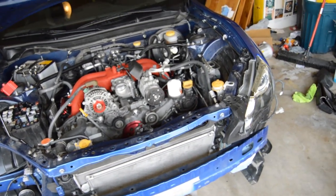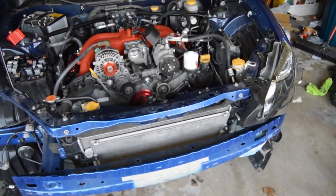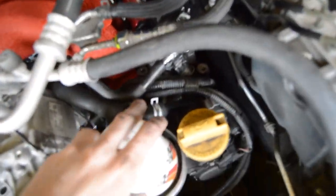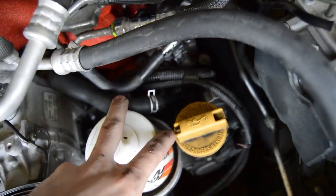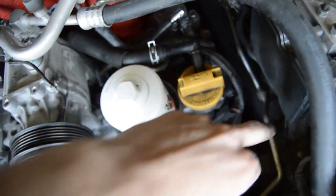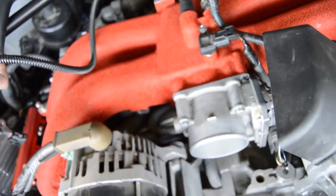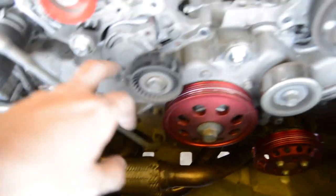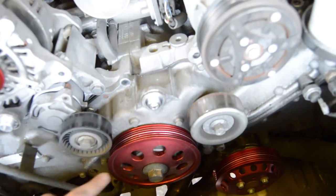Okay guys, quick recap on what I've been doing since I haven't shown the camera in a while. After you relocate the horn, relocate this breather hose that came off the stock intake, with this little piece on the end of it. Once that gets relocated over this way, you add a MAF extension from Jackson Racing that they supplied to run over to this side so that you can put the MAF over here, because it's going to go on the intercooler piping over here. After you do that, you're going to need to remove an idler pulley right here that's not going to be reused.